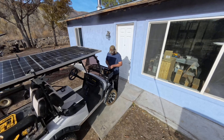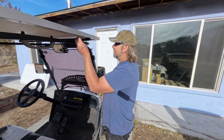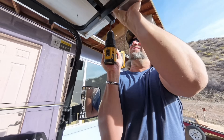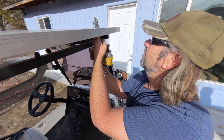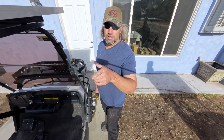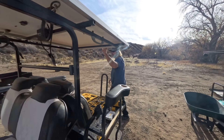I just got to drill some holes. I ended up buying some bigger boxes of bolts and nuts because I know I'm going to be doing a lot of solar panels on golf carts. This is so when I drill through, I don't damage the solar panels — it's pretty easy to go all the way through this and through the aluminum and up into there. Just got to do that five more times. I'll go ahead and do that and then we will start putting the charge controller on. All bolted down now — it looks good, I like it, I think it's going to be great.